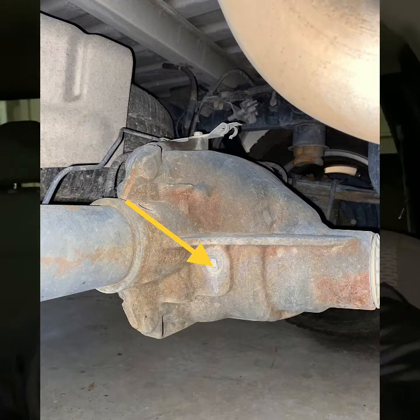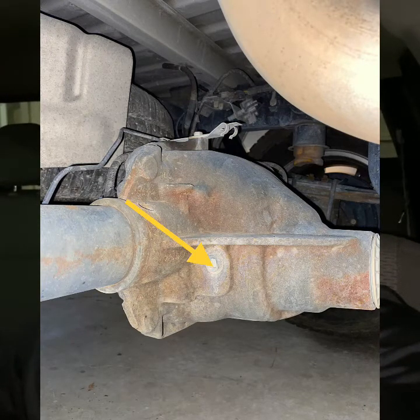I should have covered this in the beginning: the first thing you do before you start unscrewing that differential cover is unscrew the fill plug first. If you take that face plate off, do all this work, put it back on, and then the fill plug is seized up — you're in trouble. First break torque on that fill plug. I'll show a picture of where it is. As long as it's loose, clean it up with a wire brush. They put threadlock around there, or just buy a new one. Clean up the thread — don't put threadlock back on; you don't need it.